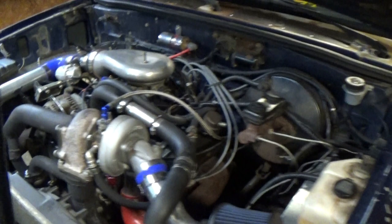First thing we will talk about before we even talk about the turbo kit is the fuel management system. In this truck I am running a MegaSquirt 2, version 3.57 board, which I think is still the latest version. This ECU was originally built and used in a 420A Mitsubishi Eclipse — a naturally aspirated second-gen Eclipse — and it needed no modifications whatsoever for me to wire it up to the 3.9 liter V6 and run it.